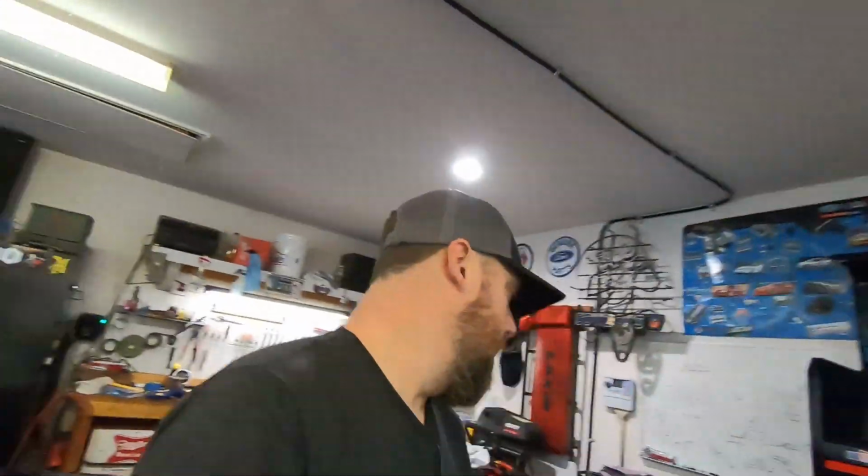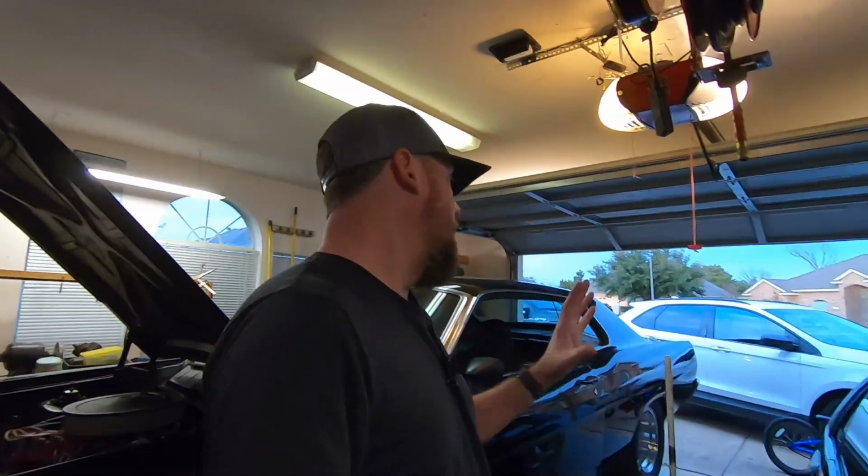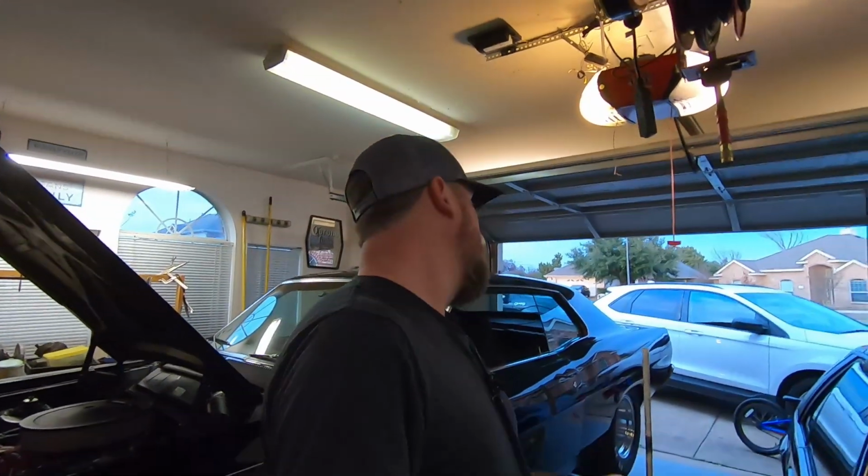This is my fault, because I emailed TCI, oh God, back in 2009. I kept the email and I still had it. When I emailed them, I gave them a long list. Guys, when you order a torque converter, you have to fill out a long spec sheet. There's a lot of things that dictate your stall speed. Whenever you send an inquiry to TCI, they ask you a bunch of questions: car weight, gear ratio, engine cubic inches, your camshaft profile, all that stuff, because they need to know that.